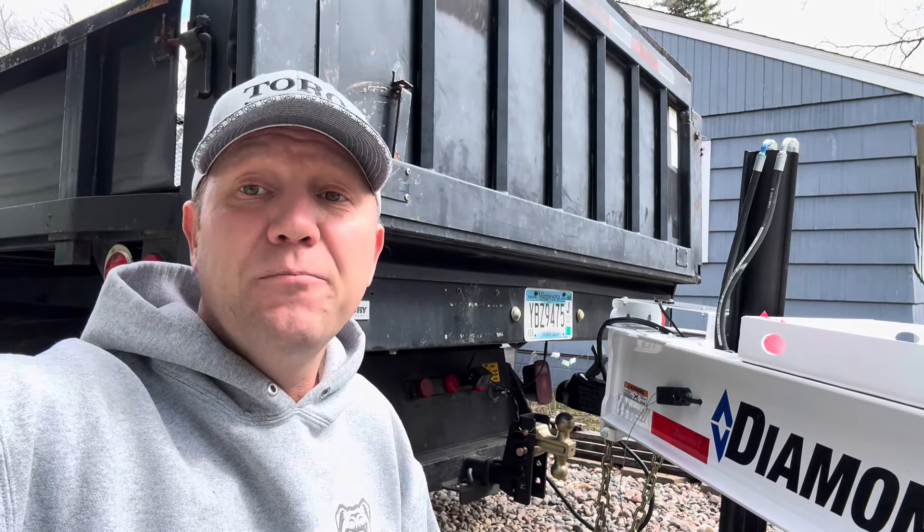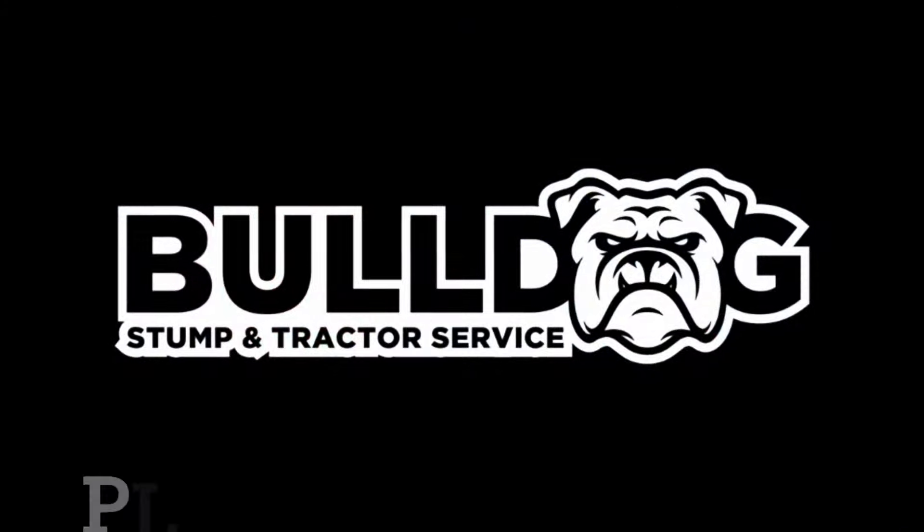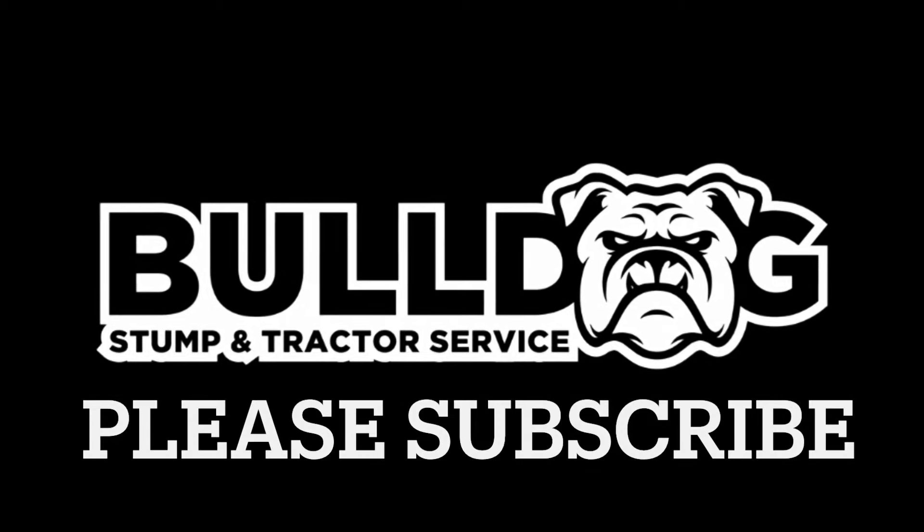That said, that's a lot of weight on a 2-inch shank. There are trailers that don't put weight onto the tow vehicle — commonly those are referred to as tag trailers or tag-along trailers. We're close to a tag trailer, but still technically just a bumper pull, and we do put quite a bit of tongue weight, so this hitch needs to hold up. That thing is heavy.